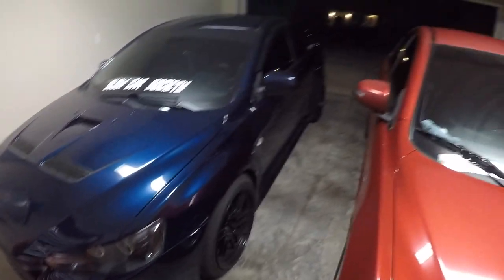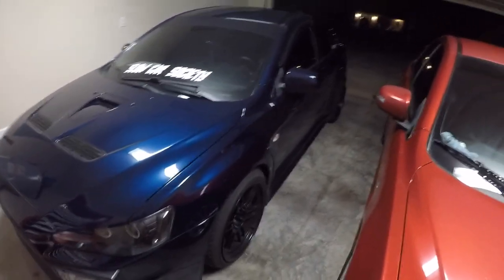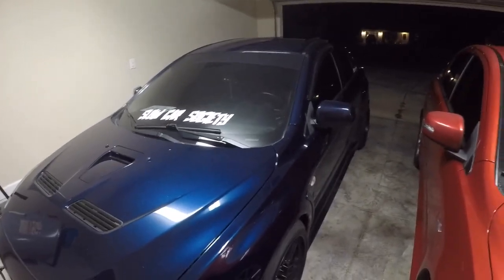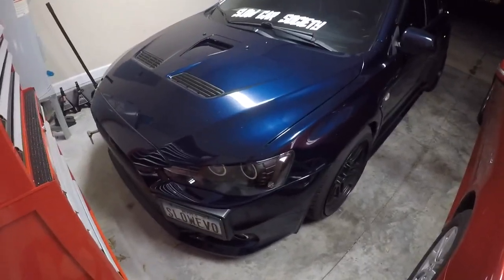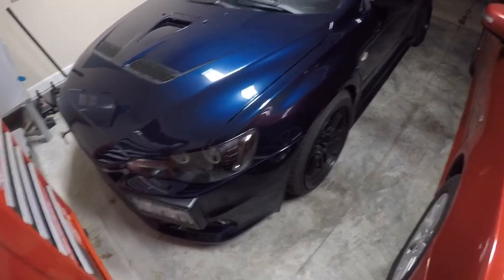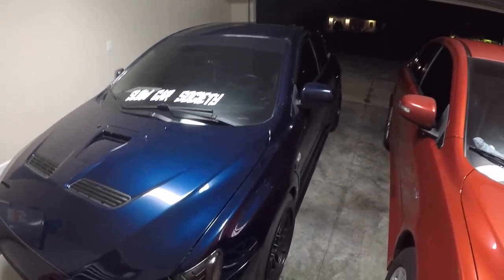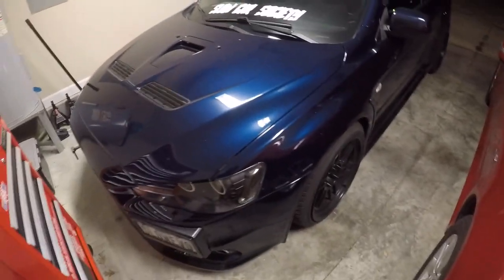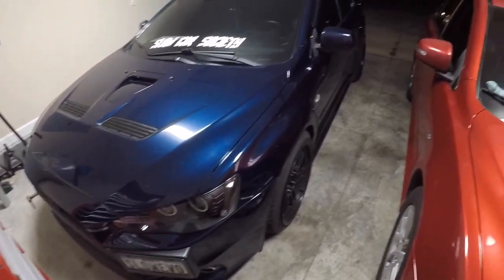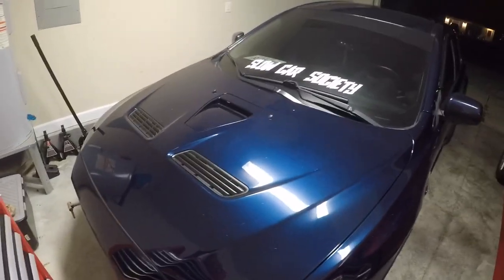Now I've got a better fuel pump so that's a plus — I also now know how to change fuel pumps in the Evo. But we haven't fixed the issue. It's not the spark plugs, it's not a boost leak, it's not the fuel pump relay, and it's not the fuel pump or filter. So next I'm going to look at cleaning the MAF sensor or possibly replacing it. I want to put my air-fuel gauge up in this pillar pod so I can get a reading on whether I'm running lean. The plugs had some black on them but weren't white, so I don't think I'm running lean.